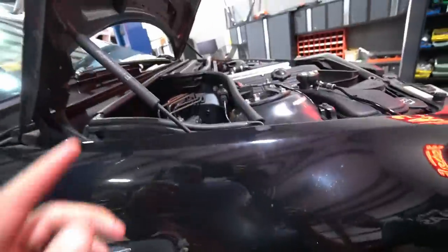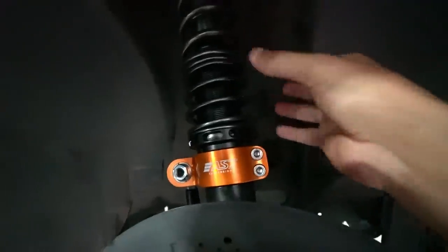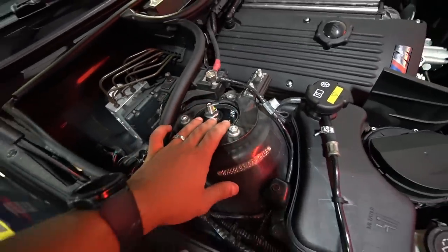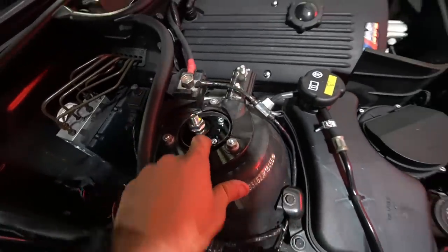Looking at the AST 5100s, you'll notice the adjustability is at the bottom — that's right here. You have 12 clicks of adjustability on the damping and rebound. Unlike traditional systems where you have that adjustment up top, this one has it at the bottom because of the inverted strut design. The concept behind that is it copes with heavy side loading and heavy brake loading. If you do end up getting a set of AST coilovers, make sure to get the optional camber plates — that's going to allow you to get perfect fitment at the front, especially if you're going with more aggressive wheels.